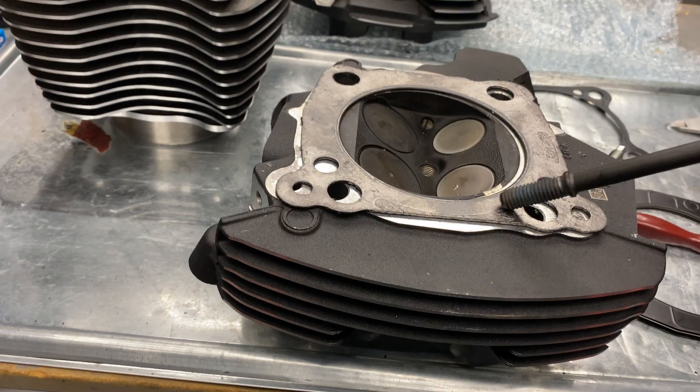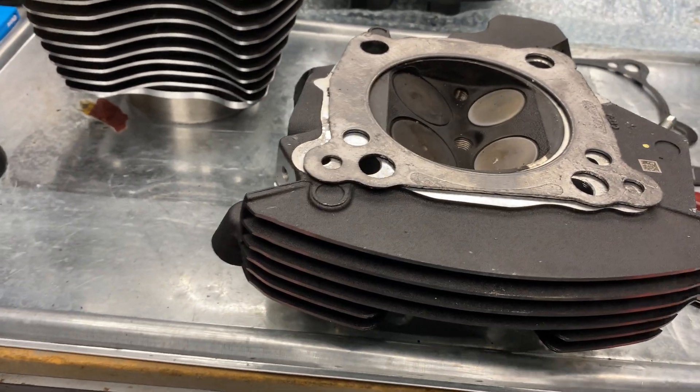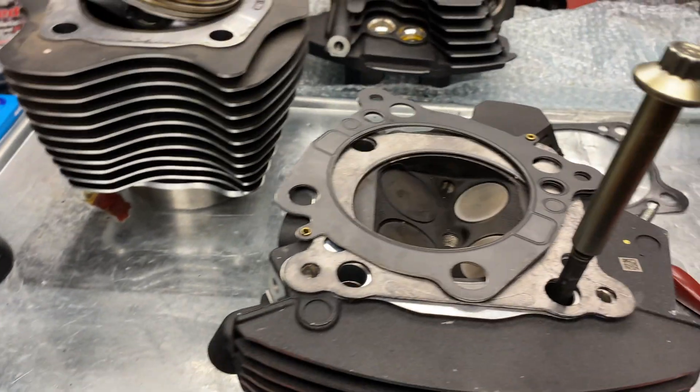I haven't had one of these multi-layer steel gaskets leak in-house as a repair. However, on all teardowns, if this head comes off the cylinder, I am swapping out and moving away from a composite gasket from factory and going to a multi-layer steel for the obvious reasons I just mentioned.